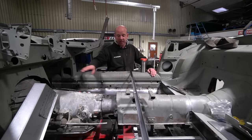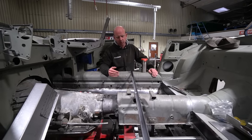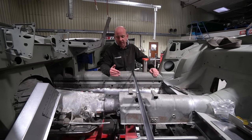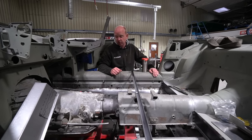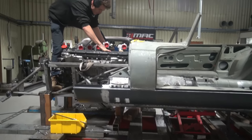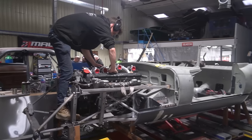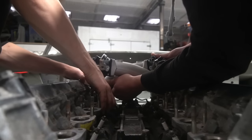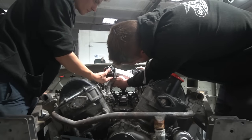Once all that's in, the sides of the tunnel and all the front section can be fabricated, because the constraining factors will have been dealt with and then we can do all the sheet metal work around those constraints. Engine and gearbox are back in, throttle body's back on because we were double-checking bonnet clearance — we've slightly changed the height of the transmission which altered the engine angle. We wanted to be sure we've got throttle body to bonnet clearance, and we do, so everything's okay under there.